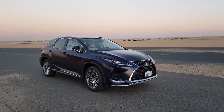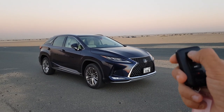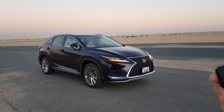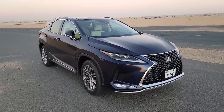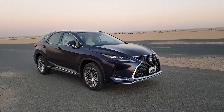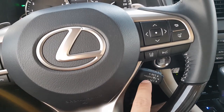In order to remotely start your Lexus RX 350, here is the key. Here is the lock button. To start it, all you have to do is press the lock button two times quickly, and then on the third time long-press it until you see the lights blinking and the car starts. It will keep the parking lights on. To switch off the car, long-press the lock button and it will switch off.